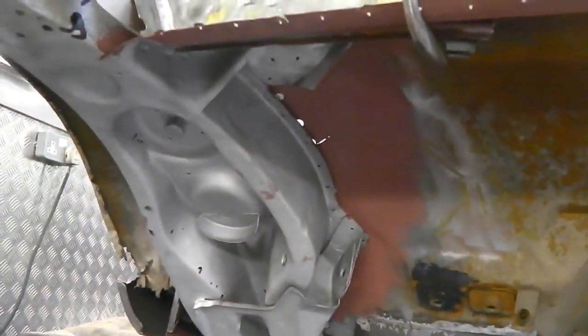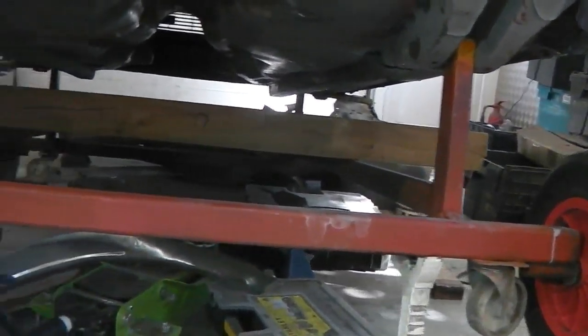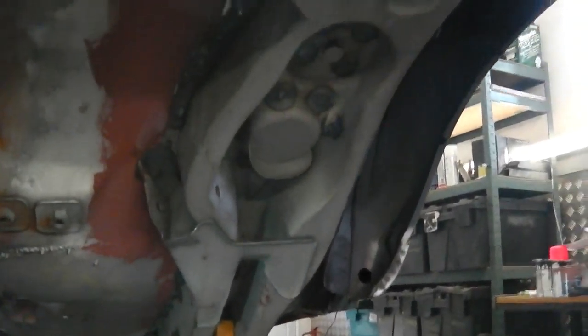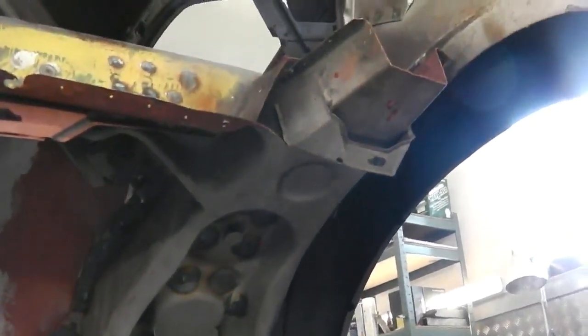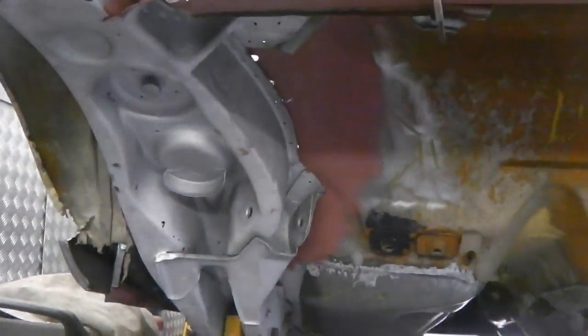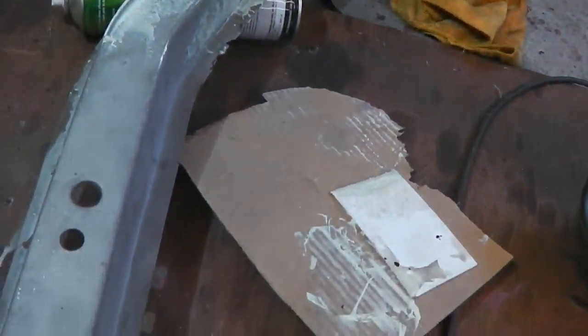If we've got to change anything, we've got a chance just to adjust here before we weld up. Although you may say it's too late because you've welded this side and they both need adjusting, but we did use the buggy dolly jig to help us, certainly with that space in there. We're going to have to go with what we've got. We're hoping for 2mm. I'll accept 3mm tolerances on this. Right, leave me to sand this up. There's no point in me filming doing a sanding operation.